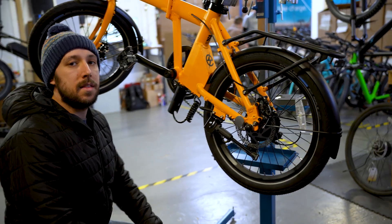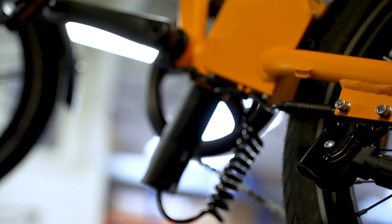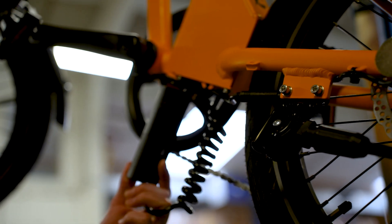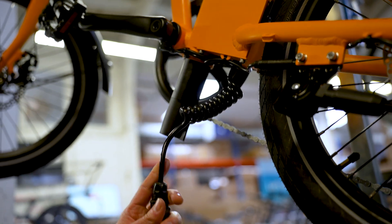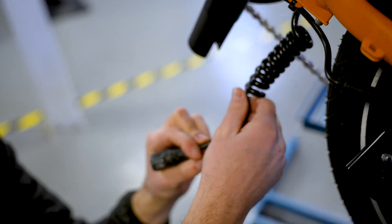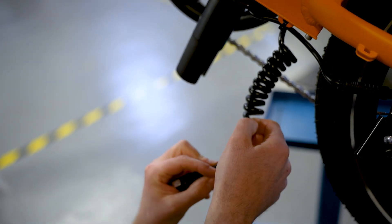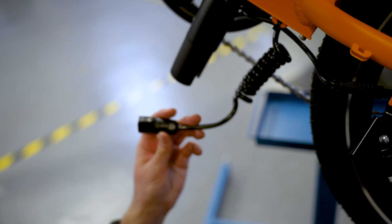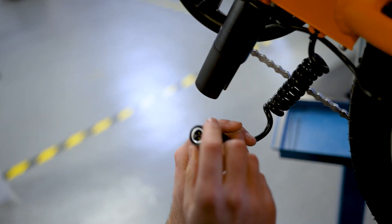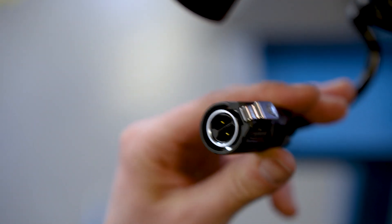Underneath the bike we've got various cables running into the controller box, one of which is the battery connection cable which you should be familiar with from plugging the bike in and out. I'm just going to unplug this — you just want to make sure that it's not kinking at any point or hasn't been caught on something. Just check every now and then that there's no obvious kinks or any exposed cable, otherwise you're going to get power issues. Also check there's no dirt inside this plug, and if there is just use something like a little brush or an earbud to clean it out.